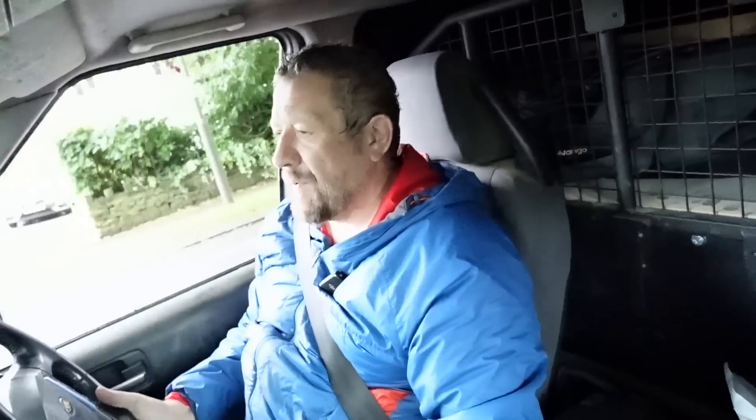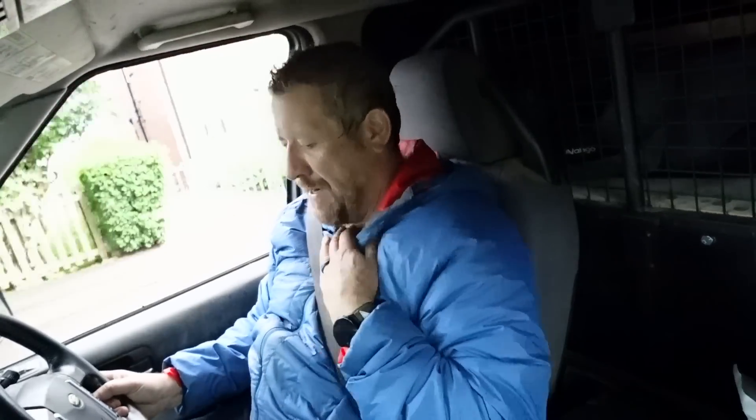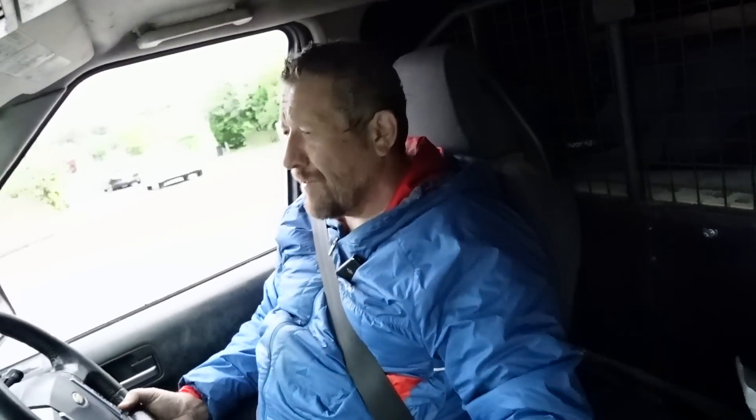She started - good. We'll hit the road and hopefully have an update soon. Limp mode has just come on. I was going up a steep hill trying to keep the revs under 2,000, went a bit above that under load, and it went into limp mode - all the warning lights flashing. I turned it off and on again and it's cleared, but I can't keep doing that. I'll do a bit more mileage, let some of that injector cleaner pull through, and if it improves, great. If not, it's going to be flatbed recovery.